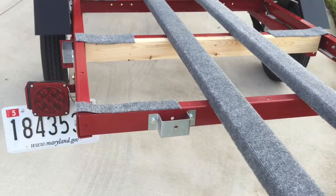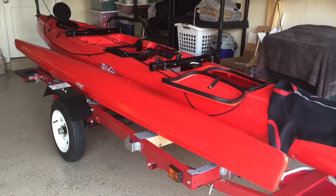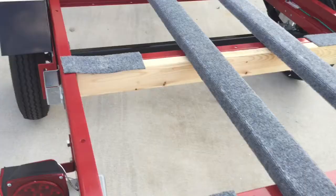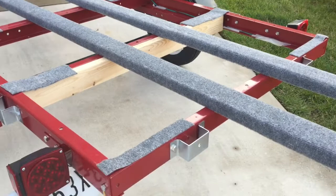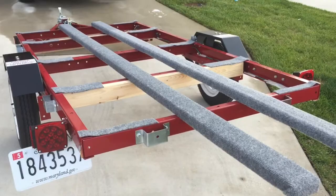Finally, the way that I do this is I put the Amas upside down on the boat so that the flat side is touching these flat areas, and I just put a little bit of carpet there as well to pad that. Then I strap the whole thing down with strapping straps and it's worked great. It holds it real tight and it's real easy to move the boat on and off the trailer all by myself. And that's how I did it — I hope that helps.